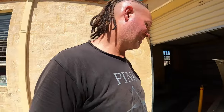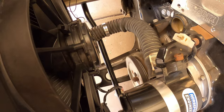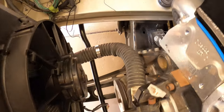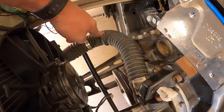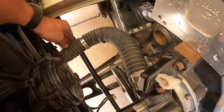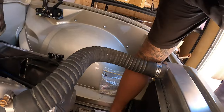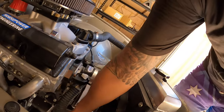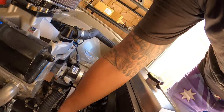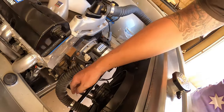Some success — I'm a bit retarded, I had the sway bar on upside down, but we got there in the end. Now that fits. I do need a shorter hose — you can see it's too long and there's a kink in it. Once I get a shorter hose that should be fine. It can even come up just a little bit — put a bit of protection around the hose or lift the radiator up a bit. I think that'll be fine.